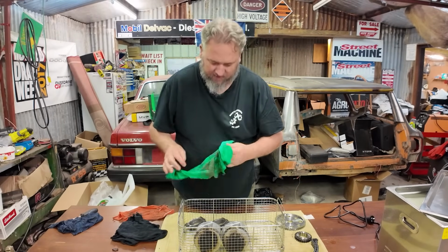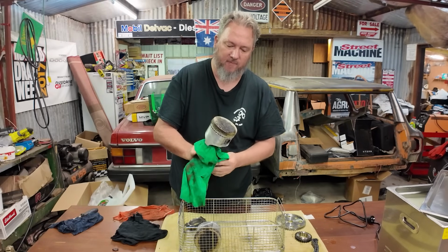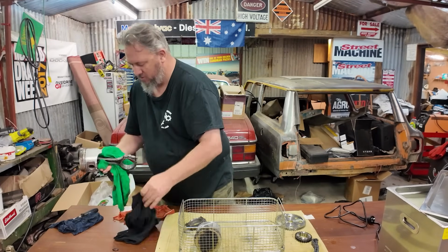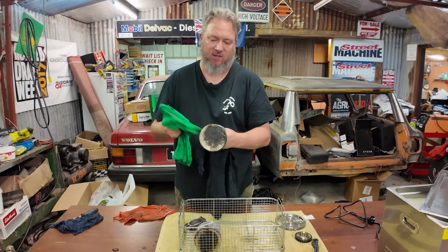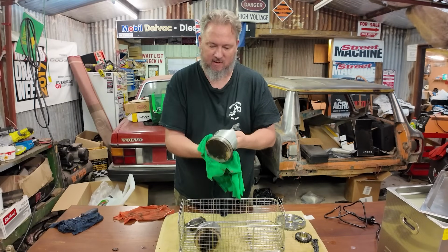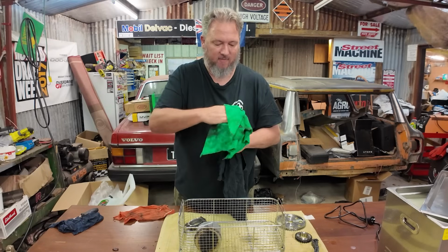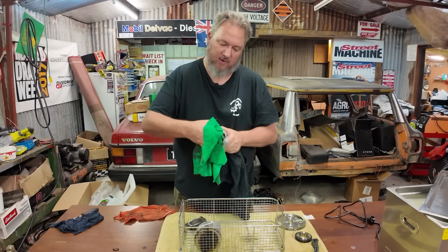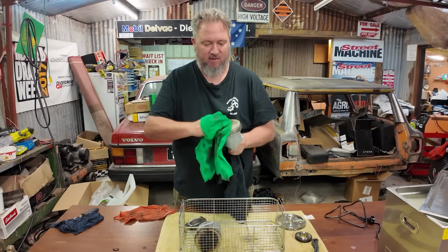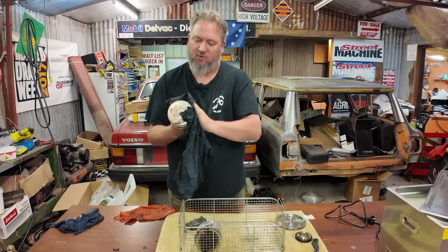So all of these pistons, it's all a bit warm. All right. Wow, that is quite warm. The top of the piston still has a fair bit of carbon, but let's hold the side for a sec. The rod and the piston itself looks a lot cleaner. It was definitely not that clean when it went in. Oh wow, the carbon's wiping off. I reckon if we were to put that in again, the carbon would soften up to the point where we'd be able to get the rest of that off completely. So that's not too bad at all.